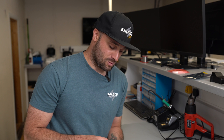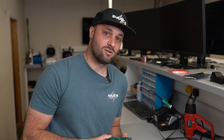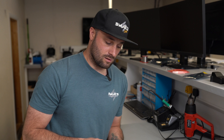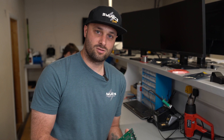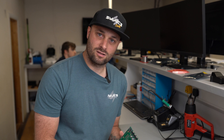What happens when you attach a large nitrous solenoid — some of the smaller ones may be okay, but we don't recommend it regardless — is that when a large solenoid turns on with a heavy pressure load behind it, it requires quite a substantial amount of current to open that solenoid and allow the flow of nitrous to pass through.